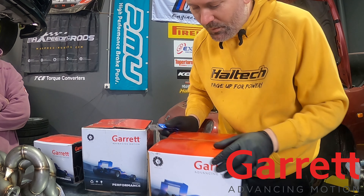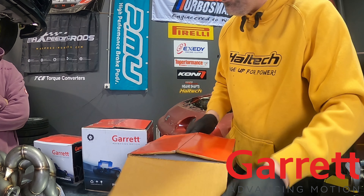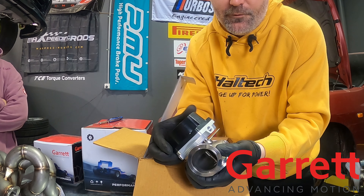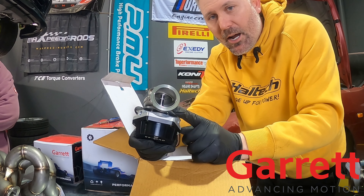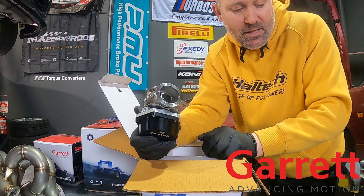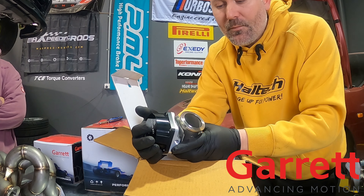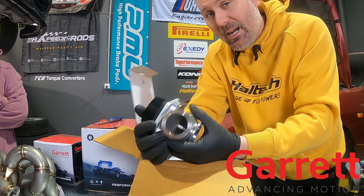We'll start with the huge wastegate - not really small. This is a 45mm wastegate, same size I have on my K-Swap, and this is a brand new product for Garrett. We've got the Garrett 45mm wastegate and this one comes with a bunch of different springs. We'll probably put one of the lighter springs in for this build because we don't want to blow it up. The block won't be CSS sleeved and we'll be running the stock pistons. I am in talks with another sponsor to try and get some rods for the engine. We're going to do bearings, head studs, and head gasket - probably make this baby pump out between 7 and 12 psi. I think we'll make plenty of power in the Teg.